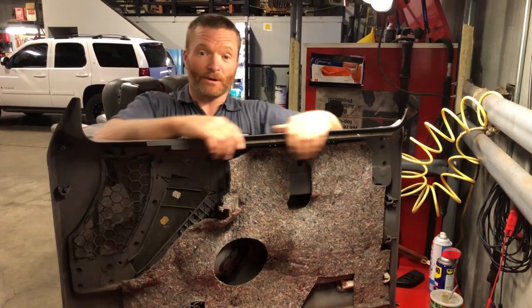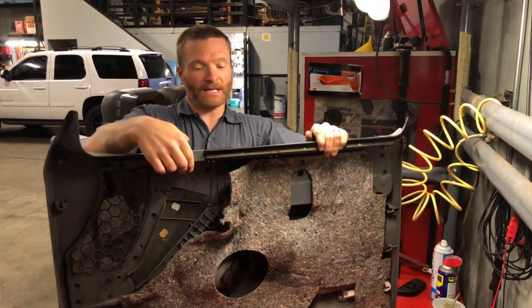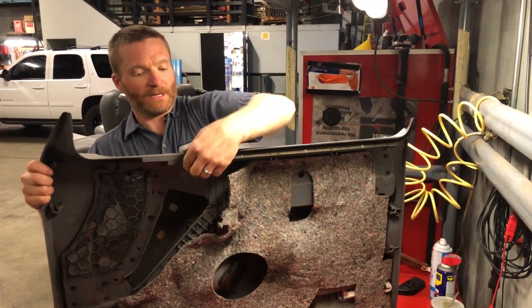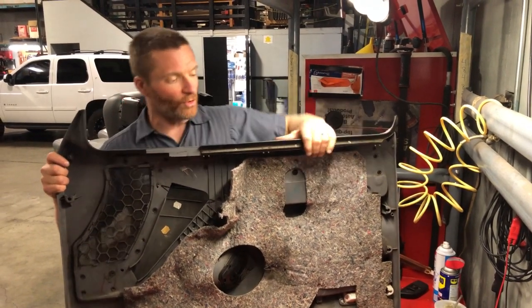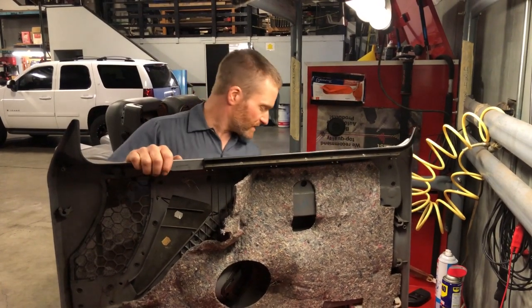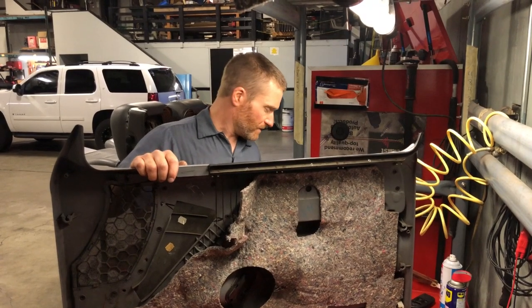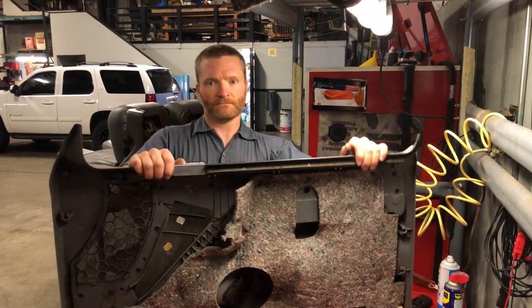That's better. So you can see we're all buttoned up here. Rivets are in, all that wonderful stuff. Good buddy of ours, Brian, has let us know that if you use canopy foam and lay it in the area that goes against the metal part of the door, it'll quiet up that creaking and squeaking sound that you hear. The rivets will have the part number in the information on the video. Remember, 1/8 inch drill bit's all you need. And yeah, people, get after it.